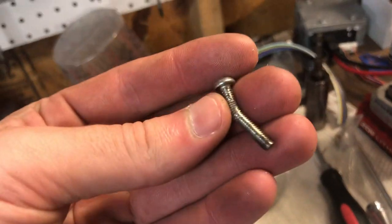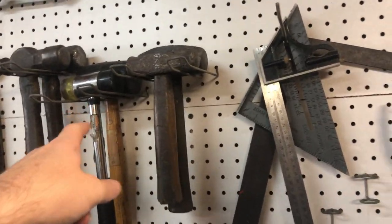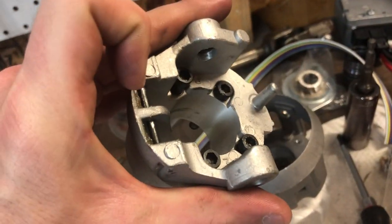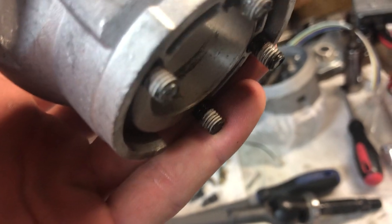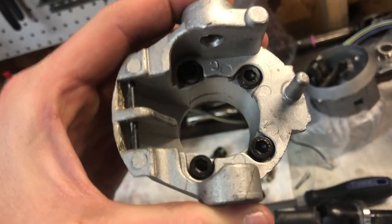You pop these pins out the same way I did it - take what I think is an 8/32 screw, it's pretty beat up but you just thread it into the hole. You can rig up a little slide hammer or do like I did - take a pair of vise grips and your good old persuader. Knock that out, this piece comes off. Then you're left with the next piece, and to release that you have these teeth for the tilt mechanism. You'll probably have to unhook the arm to pull it loose. Once loose, it's just Allen bolts - these had thread sealant, not red thread locker like the other one, so they came out a whole lot easier.